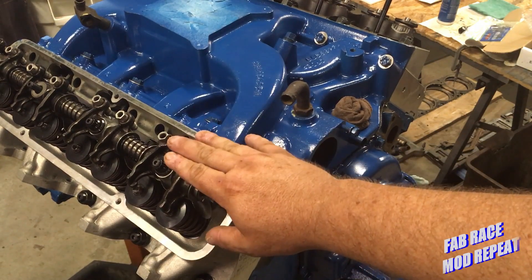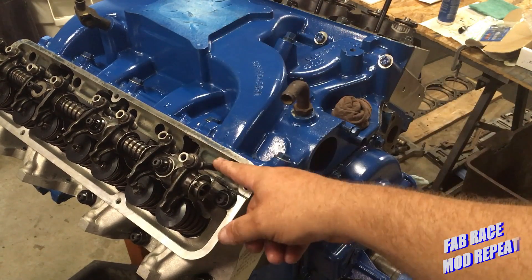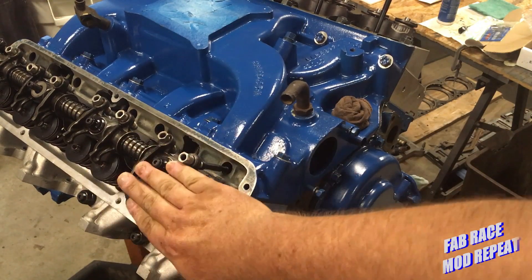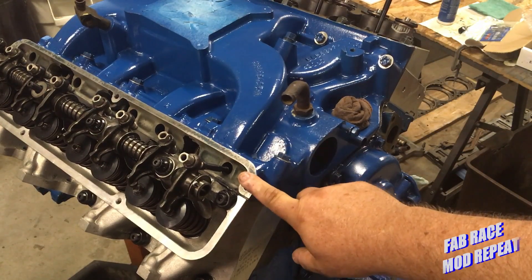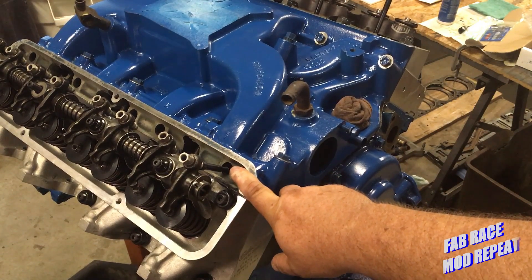They're still in good shape — we've cleaned them. A couple are aftermarket replacements but most are originals, and I need to determine the pushrod length. If I didn't have a manifold on, I'd be able to get both fingers in here and adjust. Of course we're on number one here. With the CompCam hydraulic lifters, you want 50 to 60 thousandths preload, so I'm going to set this at 55 thousandths — dead in the middle of the tolerance.